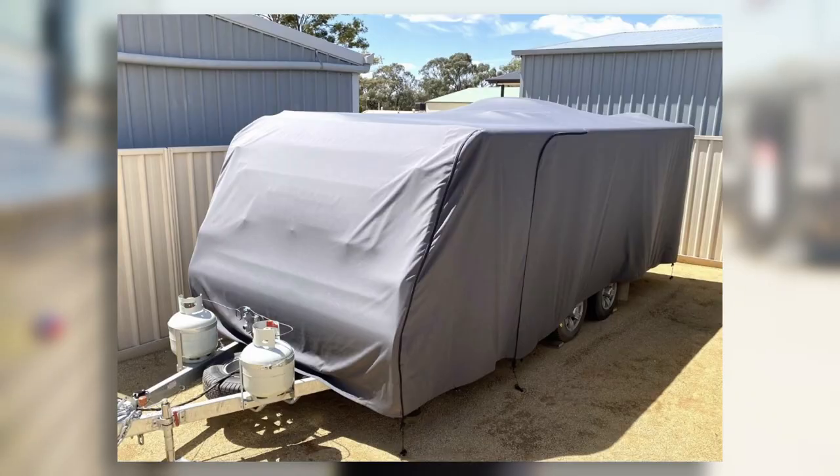If you're lucky you'll have a shed or undercover storage, so you won't need a cover on your caravan. If you do have a cover, make sure it's a very well-fitted caravan cover. A lot of caravans get damaged because you get a 22-foot cover for your 20-foot caravan — the wind will blow it too much and it will actually wear the side of your caravan. Make sure it's a nice snug fit.